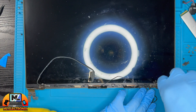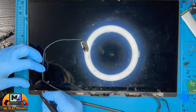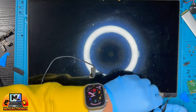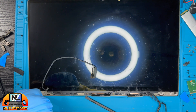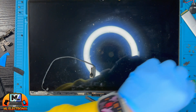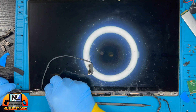Remove the inside screws of the laptop hinges and the two screws from the LCD panel. Take away the plastic cover near the hinges and unscrew the last two screws holding the LCD panel. This LCD screen has hidden adhesive, so carefully remove it before taking away the LCD screen from its cover.